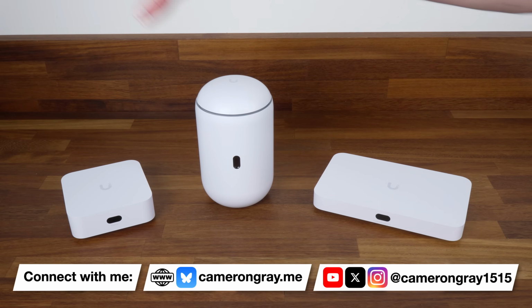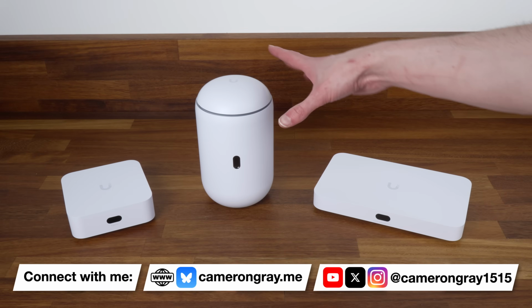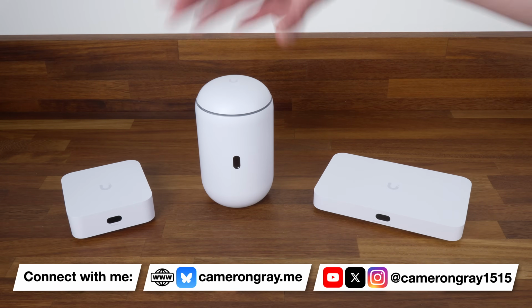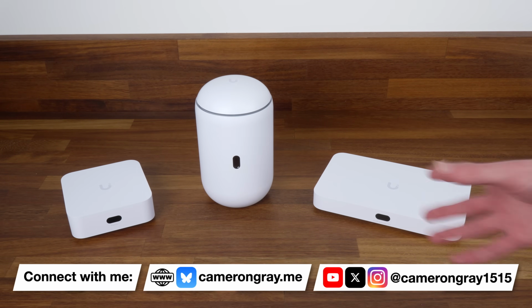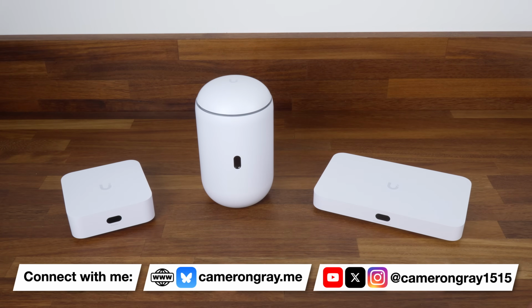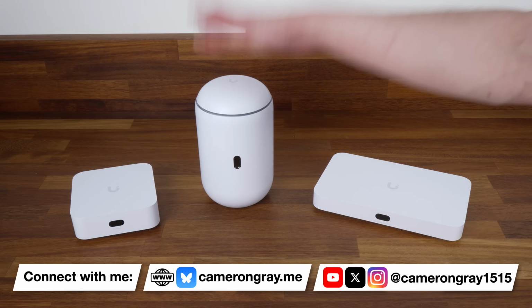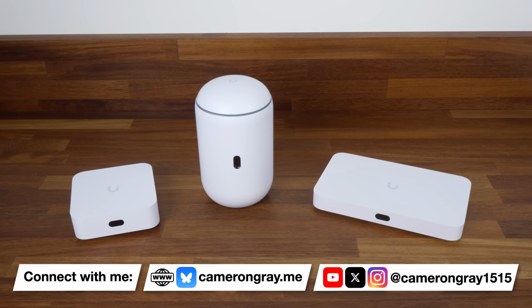And then both of these have the built-in Wi-Fi, which is absolutely fantastic. Of course, with Wi-Fi 7 and the 6 GHz band, you are going to start needing multiple access points around a building. You couldn't really have one of these in the corner of a large house and have it cover the entire house with super high-speed Wi-Fi. But of course, with the ability to add an Express 7 to your UDR7, that could work really well.